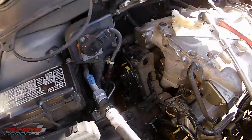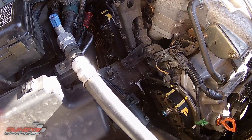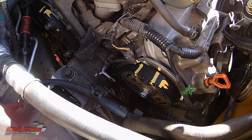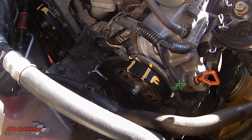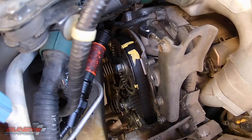This is an ongoing series for the timing belt on a J-Series Honda V6. Got the two upper timing belt covers off. I went ahead and marked them with nail polish - marked that one with nail polish as well. I just marked where top dead center is. You'll see when you get in there, there's a mark on the sprocket and then there's a mark on the back cover. Same on the back too.